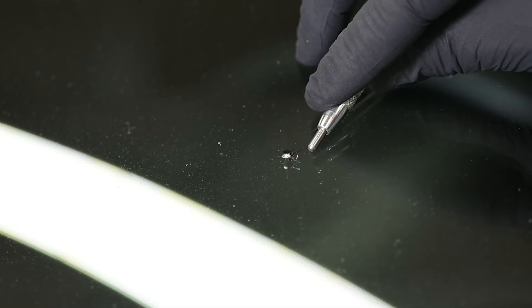The first thing we're going to do is evaluate the glass. Before you evaluate the glass, make sure you're working on glass that is between 35 and 85 degrees. Within that range, take the blunt side of your pit probe and check the volatility of the break by pushing on the cracks to determine if you have a stable or unstable repair. That will tell you how much vacuum or pressure you'd want to apply if using the Wizard in manual mode. Then we'll go ahead and clean the pit.